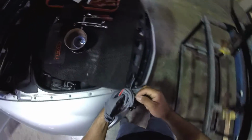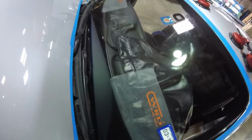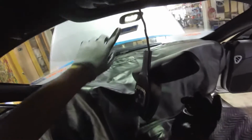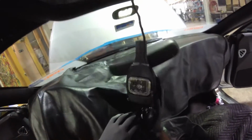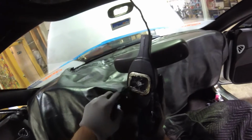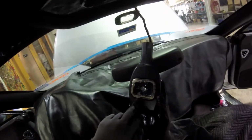Okay, so we're going to start stripping this car. As you see, the glass has lamination, so big bubbles are coming up in this area. The glass was also replaced before, when it was installed in the process of converting to bulletproof. They used Loctite. Remember, Loctite is not allowed on any glass, especially plastic. This guy has to clean this bracket and they must put urethane, because urethane attaches better to plastic. Remember, this is the bulletproof, it's plastic, so it's not going to attach like it does to glass. So they crystallized the Loctite and it fell off.